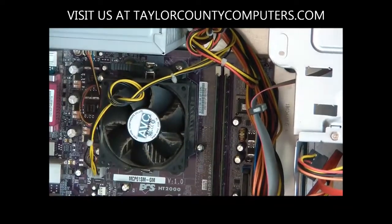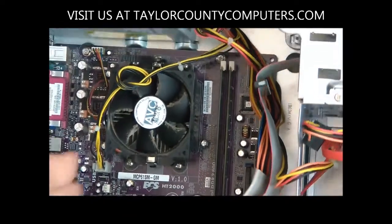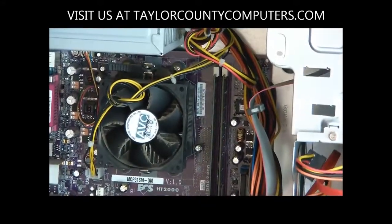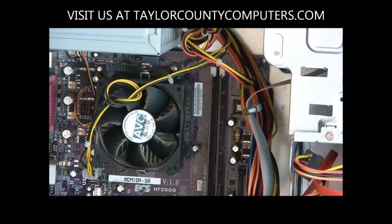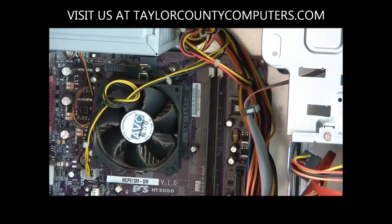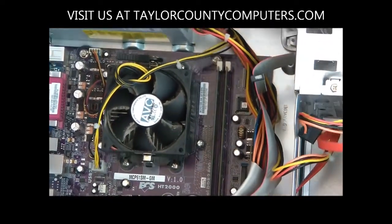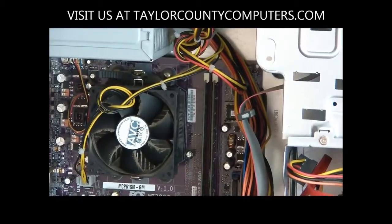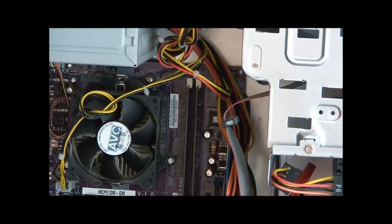But if you get dust inside those vents or between those fins, it almost works like insulation and can cause it to overheat. So you want to make sure that it's nice and clear of all that by cleaning it out. And of course your fan, like I said about your power supply fan, this fan can get clogged up, get thrown off balance and start making loud noises. It can fry your bearings when it gets too hot because it's running too slow, and then it eventually will stop completely, possibly fry the motherboard, definitely fry your processor, and all that stuff gets expensive. This maintenance that we're doing today is a total investment of about 12 bucks for canned air and a little bit of your time.